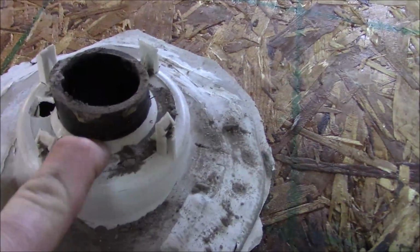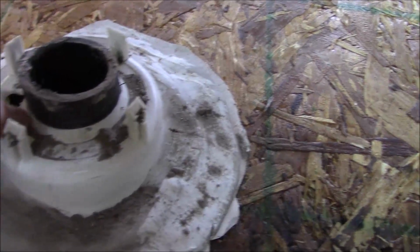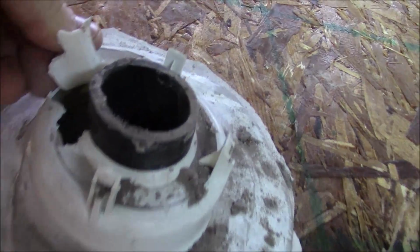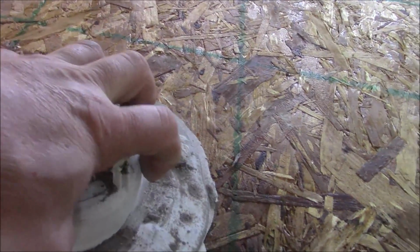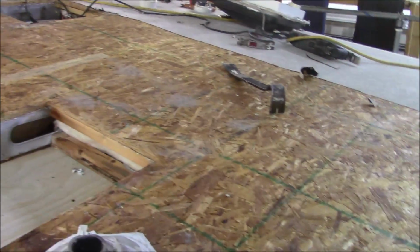And then you can see how they have these caps. If these breach, you can see someone sealed in there. Well, that's a piece of plastic. That lip edge is plastic, it's not caulking. So if the cap did pop off, if this is breached like that, water is going to go down there. The way we do our boots, it can't do that. This may have happened when one of us tried to pull this off. It's all junk anyways, we don't use it. But just keep that in mind when you go to inspect yours. Make sure those are sealed right there, even though the cap's going on it. You're going to get driving rain and everything coming in from different directions. You want to make sure that's sealed. You see all the slobber and caulking all over this thing. Gee whiz. All right, we'll show you more as we go along.